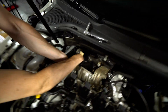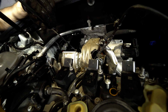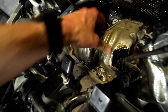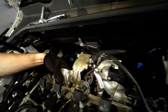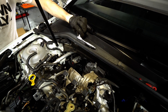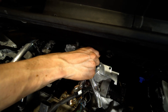It's a 5.5mm hex for the heat shield bolts. We got that one out — there's just that one and then the nut up top. That one's right here. This is a peach — maybe that's a 10? Yeah, 10mm for the feed, and that is very loose.